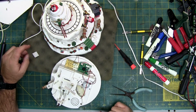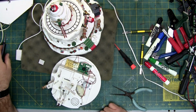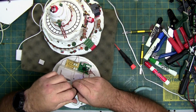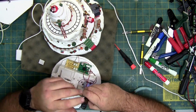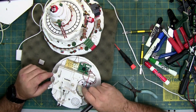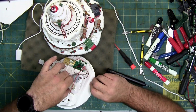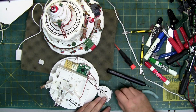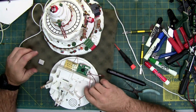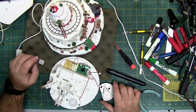So if you take it apart, be very careful that when it comes apart, if it comes out at an angle, it's going to break this paddle, which I'll try and figure out what that is in a couple of minutes. Next, let's get this assembly out so we can change this motor. Screws out of here. So it's just a little tight because of this speaker wire. So you could unplug the speaker wire and reroute it. They have it routed under the board to pull up some of the slack, but it's in the way of the motor.